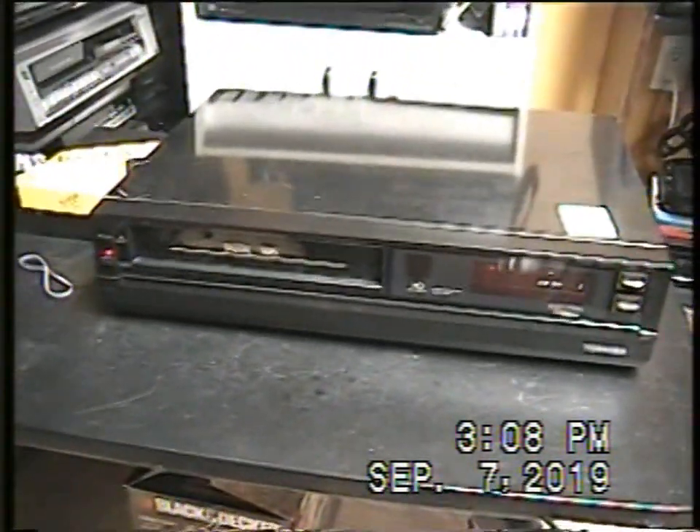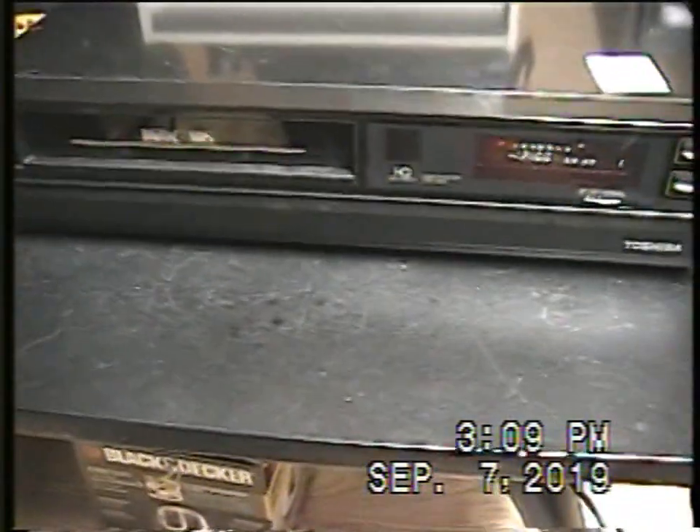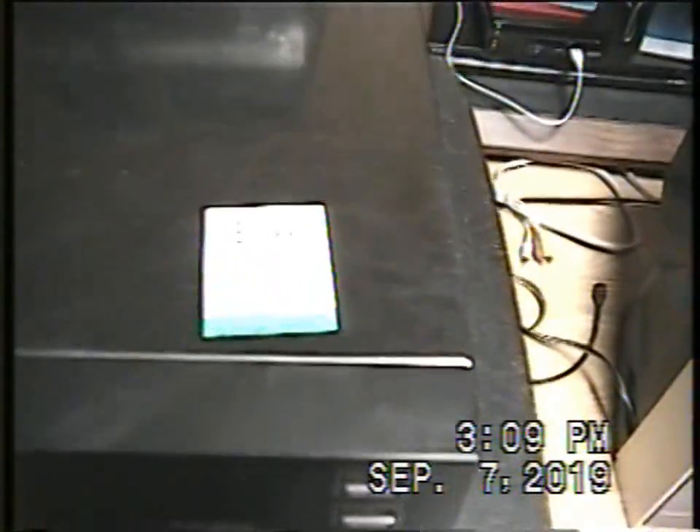It had the TV Still function. I tested this VCR there and it did exactly like I expected: I put in the tape, it went in, I pressed play, I heard the loading motor running, but it did not load the tape. It most likely just has a bad belt. Since it's defective, I told an employee so I could have it for a lower price — that's what I do when I test a VCR and find it broken. I tell an employee, they put a new price on it, and I got it for that price.